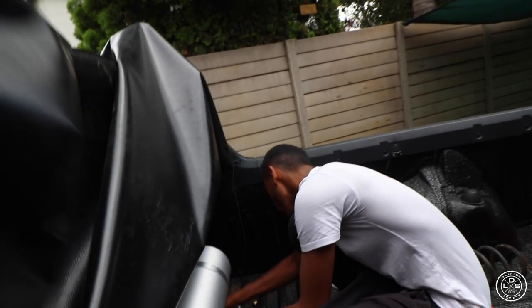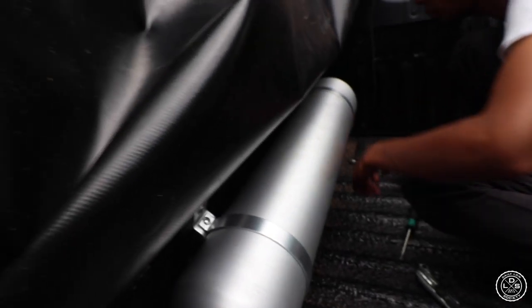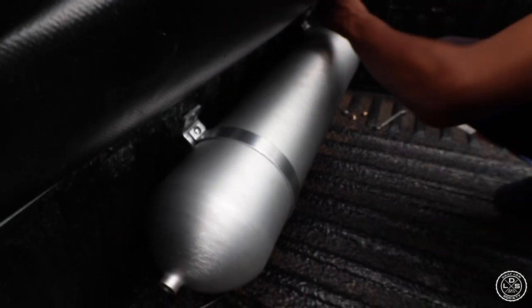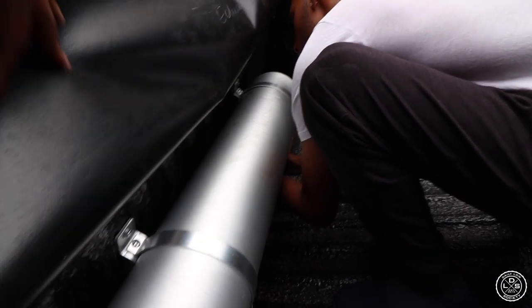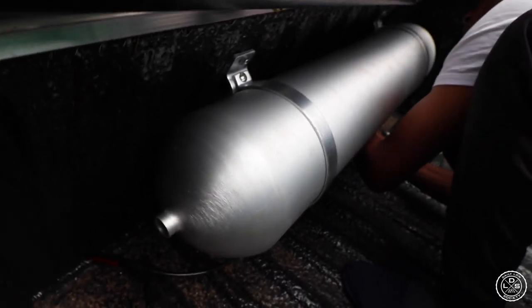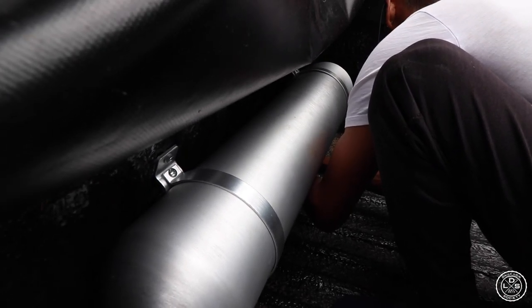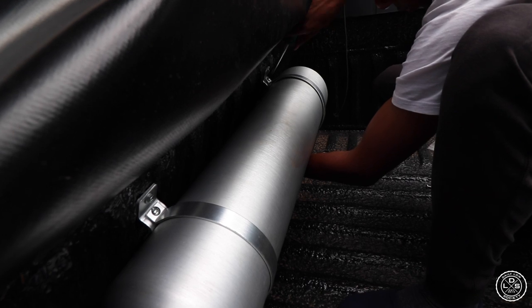Okay, so we were twakies. Well, maybe I was a twakie. Or all of us were. We never put the airline from the tank to the solenoid block. So now we need to swap around the tank, because on that side of the tank it has more room for fittings. There's only one, which the pressure switch goes on. So we need to loosen the tank, turn it around, remount it, put the fittings back. Okay guys, I think I'm gonna close off the video for today.